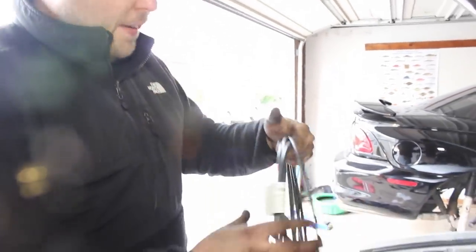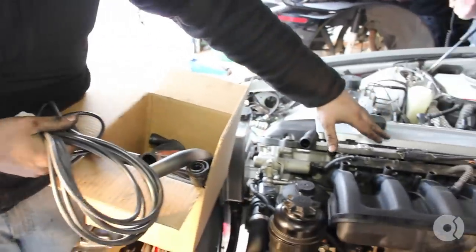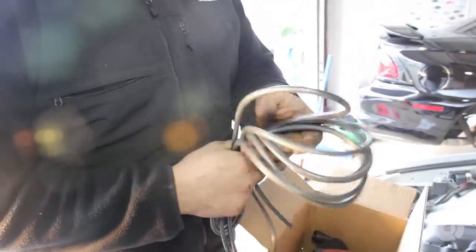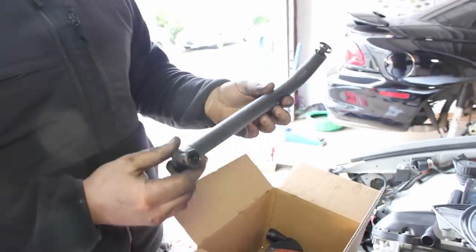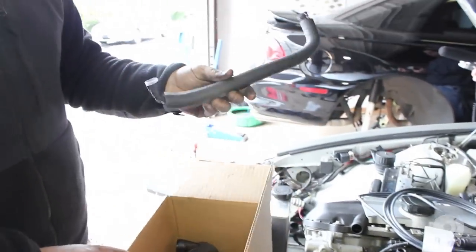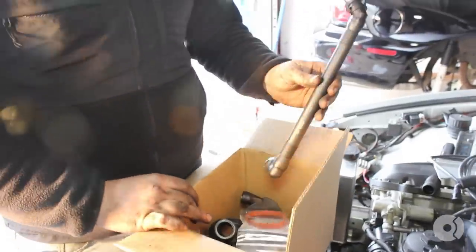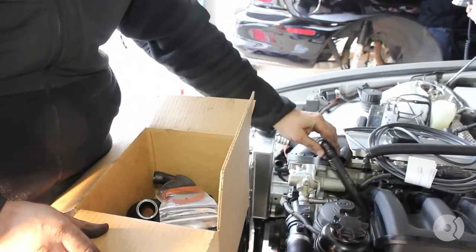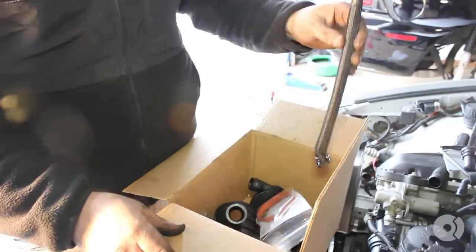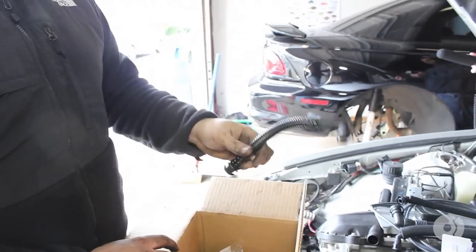With all the old stuff out, here's some of the new parts. Here's about 5 meters of vacuum line — this runs from the fuel rail down to the breather. Here is one of the breather hoses — the one that sits up here underneath the intake spreader; this one is from Meyle. Here's another Meyle hose — the main hose that comes up to the valve cover. This is the drain hose, which goes back down to the dipstick; this is made by CRP. And here's another breather hose that comes up to the intake spreader from under the intake manifold.